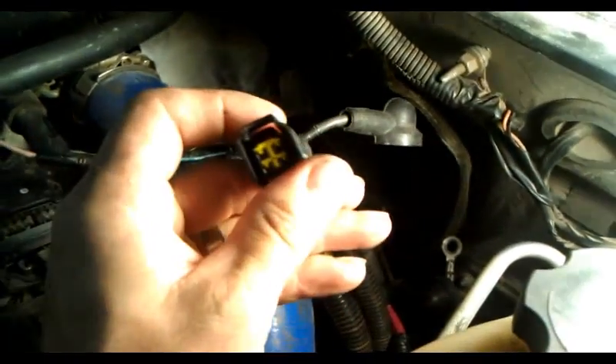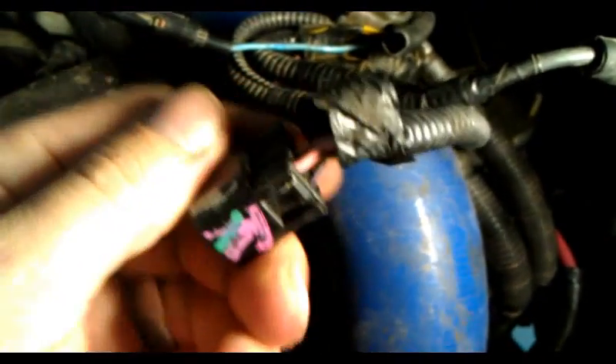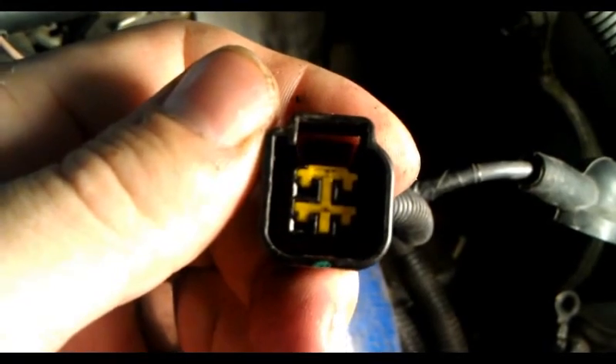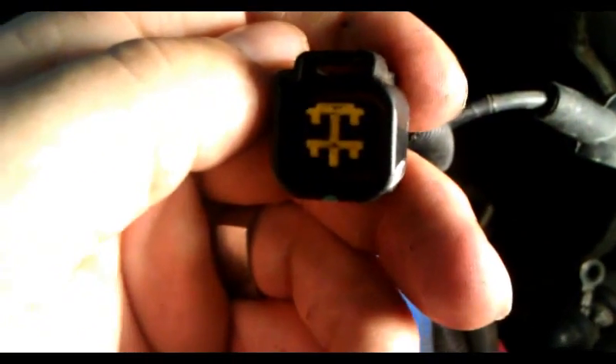This little plug is the command circuit for the relays. You've got to look at the wires on the back side. You find the yellow wire and the pink wire with the yellow stripe, which are side by side — the top two wires. You have to make some kind of a little tester lead that will plug into that and then you can test to see if voltage comes out when you turn the key on. When you turn the key on, you'll get 12 volts coming through for about 10 seconds and then it'll shut off — that's it turning the glow plugs on. If you don't have voltage, then you probably have a wiring issue.